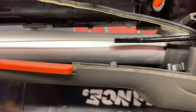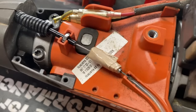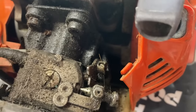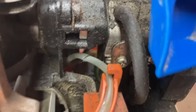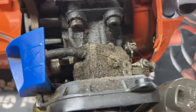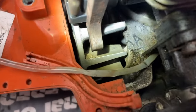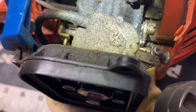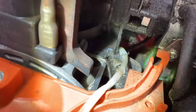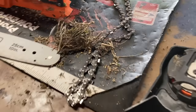I get everything where it's supposed to be and put it back together. This is the most unfun throttle control assembly to reassemble. But lo and behold it's still not working - it goes down but only comes half up. I look on the other side of the carburetor and the spring that returns the throttle lever is broken. It needs a carburetor at $122, plus $40 labor, probably a throttle cable, and a plug - the customer is looking at around $200. This one is getting double-X'd. It was a huge waste of my time because they're definitely not going to want to pay for the diagnostic labor.